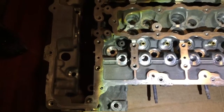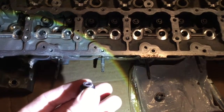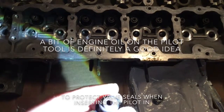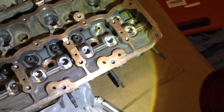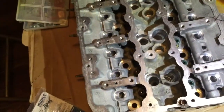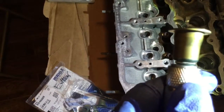When you insert the seal on the tool, be careful - there's a little spring and you don't want to damage the inside lip. A little drop of oil on the tool would be a good idea. Take your time when aligning the tool because you don't want to damage the valve guides either. It's pretty easy - just a matter of not damaging the surfaces. On the exhaust side it works exactly the same way. I used a 5.5mm tool because the 6mm was a bit too tight, and I put the washer on it.